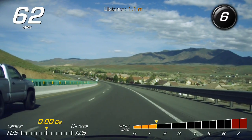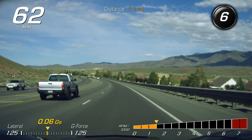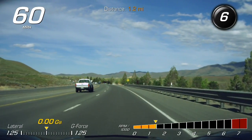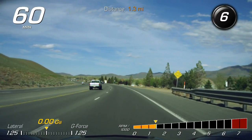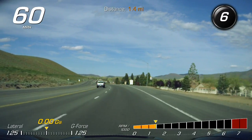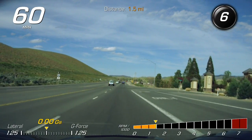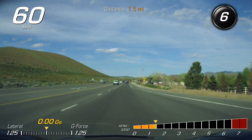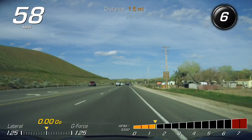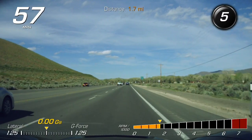Back to the launch control. What I found is on the 2017 Corvette, the launch control is different — it will adjust your launch RPMs based on ambient air temperature. When I first got the car, I thought maybe it's holding back the RPM because of a break-in thing, maybe it waits till it gets to 1,500 miles. I'm now at 1,678 miles, and what I'm finding is it's still adjusting with the ambient air temperature.